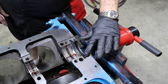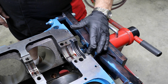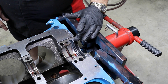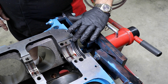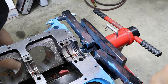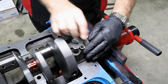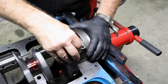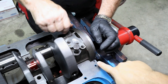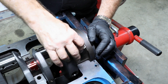That's just a little bit of additional insurance. Some people don't do that and that's fine, but we choose to do that because we have seen situations where caps are put in place and you still get that oil leak from the rear seal. This is a little additional incentive to help prevent leaking around the seal area itself. This one has the seal on it as well — no need to show you because you've seen this before on the 349 build.